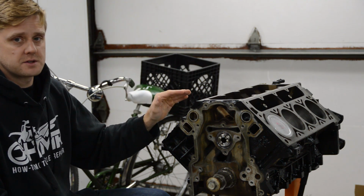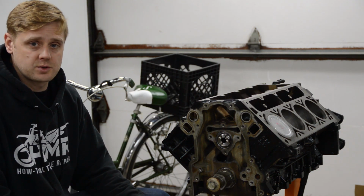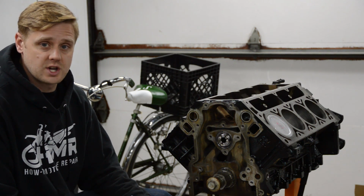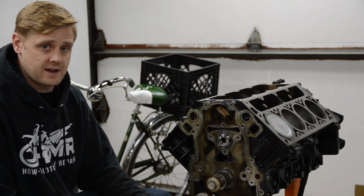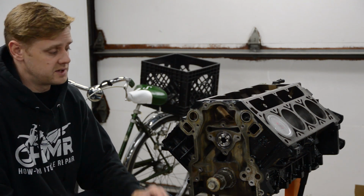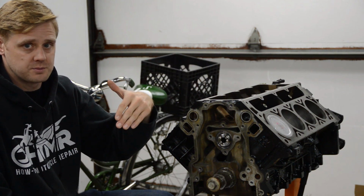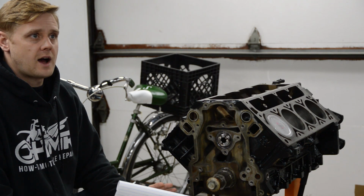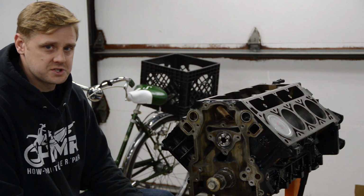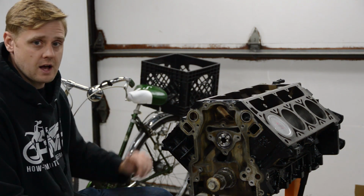The heads, running the stock heads, I sent them to a machine shop for a valve job, okay? A 3-angle valve job. Cost was like 325 bucks since I blasted the heads, and all the guides were in good shape, so they just cut the seats and the valves, okay? And they also set up the PAC 1218 springs for me. There's a certain installed height. I just let them handle it because they need to put springs on in order to vacuum test it and all this good stuff. So I beat the topic of the cylinder heads to death, and I was hemming and hawing on whether I should just lap them or whatever, but fresh valve job on the heads.